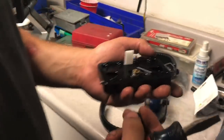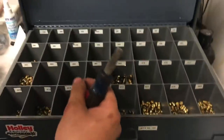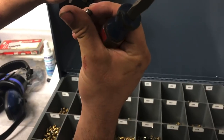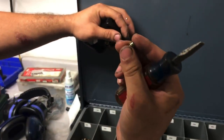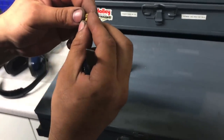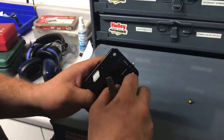Alright, so what are you changing? Changing the jets. We had 88s in it. And then we've got to go two down, so we're going to put 86s in. Make sure that they're both the same — just because you get them from the bin doesn't mean they're right. Check your jets every single time. We grab our 86s and again double-check your jets. Make sure you're grabbing the right ones — somebody might put a 68 in there a little dyslexic.